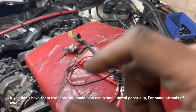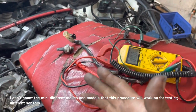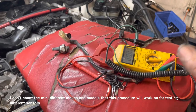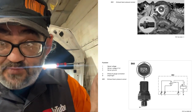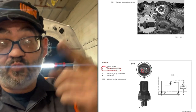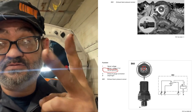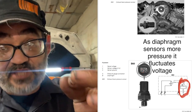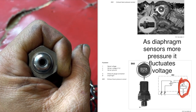We're going to do some simple fundamental tests and show you how it works. This will lead you into other avenues when testing other three-wire circuits. Like I said, they generally just send in voltage and send out voltage, telling the computer what it's doing based on the voltage. We need to understand how this sensor works, so first we look at the diagram. It has three wires: one for five volts, one for ground, and one for output sensing to recognize the fluctuation of the diaphragm in the sensor.